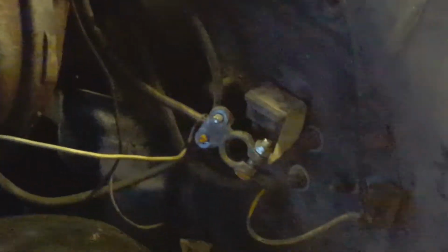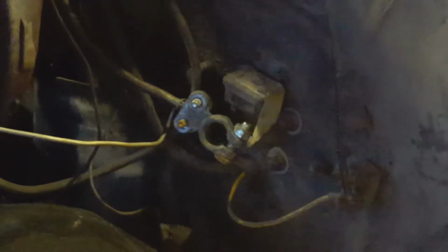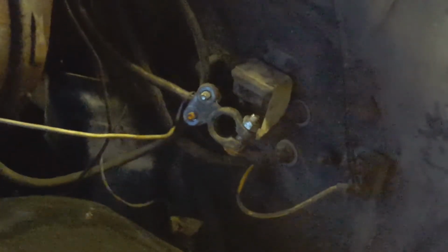All right, so that was interesting. This is the yellow wire coming from the top switch. It goes to, I'm not sure what that is, apologize for the lighting or the lack thereof, a fusible link, I guess that's what it would be called. This goes to the battery. So what's happening is this would allow you to have power at that switch without the engine being turned on, so you could lower the top without having the key, which would be handy if you're in a rainstorm all of a sudden and you didn't have the key handy and you wanted to get the top up, you could.